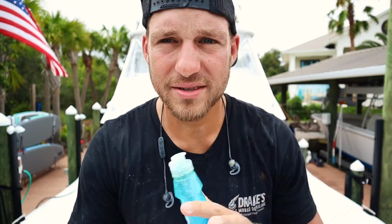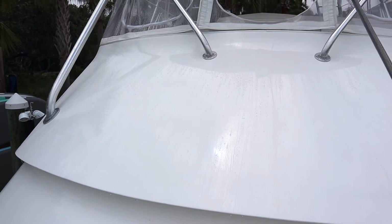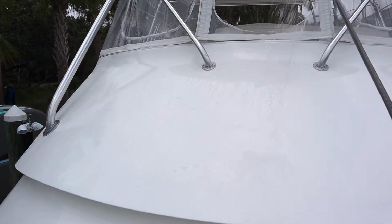We are completely finished with our correction process. So what we're gonna do now is wash it with some Dawn. Dawn is gonna strip off any oils that are left over from the polishes. There's always oils like this. You'll wash it, it'll bead off, because the polishes have fillers, and even though they say they don't have fillers, they're gonna have silicones and that kind of thing.